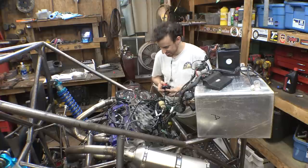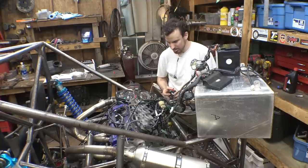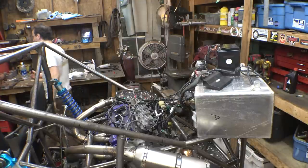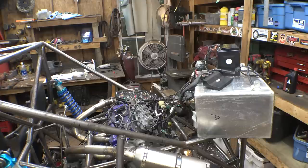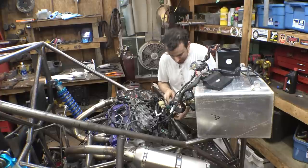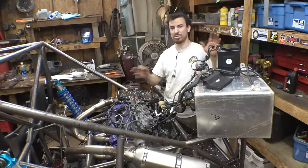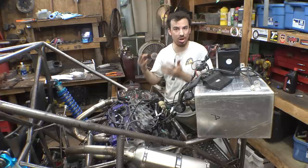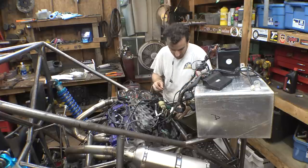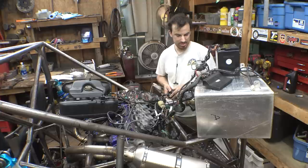It's on. It's in neutral. It might be that maybe the clutch sensor is not... I don't know. These things are always super finicky with the clutch sensor, the kickstand sensor, so... White is the clutch switch, black and yellow, black and white. So I don't know if you guys remember, but with the CBR1000 engine, I had an absolute nightmare trying to get that thing to at least turn on. It took me like 4 days of searching through wires to finally get that thing to turn on. Fuel pump's not kicking over still.